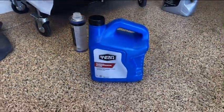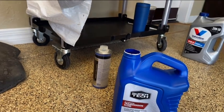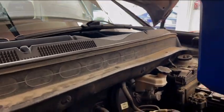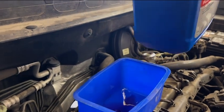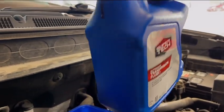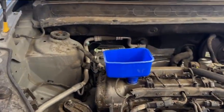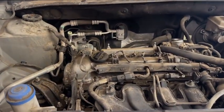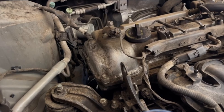You're not running this thing for 50,000 miles, so you can go ahead and get the cheap ATF. I actually saw a video where a mechanic was almost implying that the synthetic stuff doesn't clean as well as the cheap stuff. So I got this SuperTech at Walmart — super easy to get. I'm putting about a quart in. We're going to start this thing up and let it idle for 15 to 20 minutes. Liqui-Moly is in with a quart of automatic transmission fluid. The lifter is kind of clicking right now — we'll see if it sounds any better afterward.